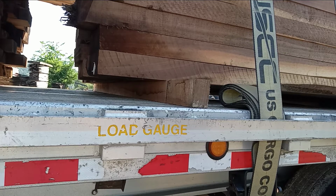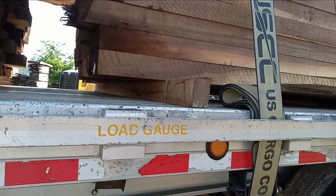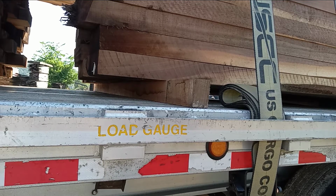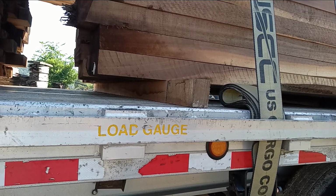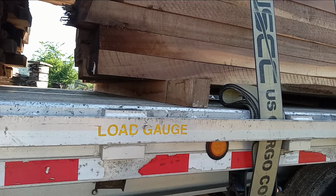So remember, every 8 feet on the load, you want to have a 2 foot securement from the first strap back, and then every 8 feet to equal the weight that you have. But this is a different bundle, so it's going to be a different weight. It's going to be less weight. You're not going to have a full 45,000 pounds. You're strapping the weight of the bundle that's on the load right here. So, if that makes sense.